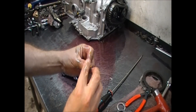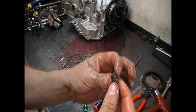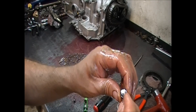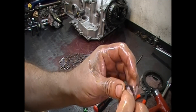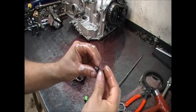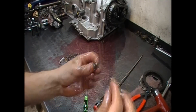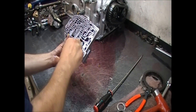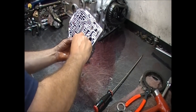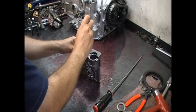When they get a little shiny you know that your valve is getting worn out. I'm going to use one of the end plugs as an example. You can see this darker grayish coloration — that's aluminum with some kind of electroplating, called anodizing. Whenever you see bare aluminum, it's worn out. This wear is at the edge of the plug and doesn't really matter, but if you see bare aluminum where the valve actually rides inside the bore, then you have an issue and that valve needs to be replaced. Sometimes they get hung up coming out.